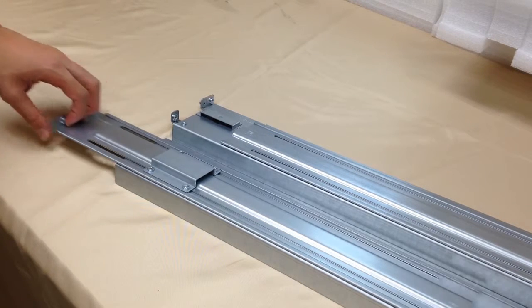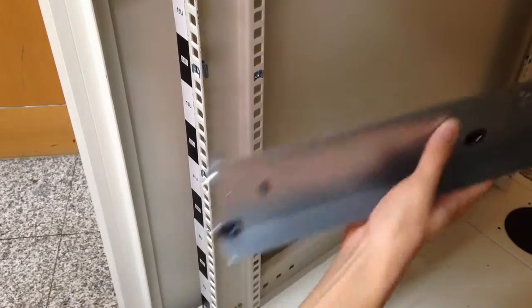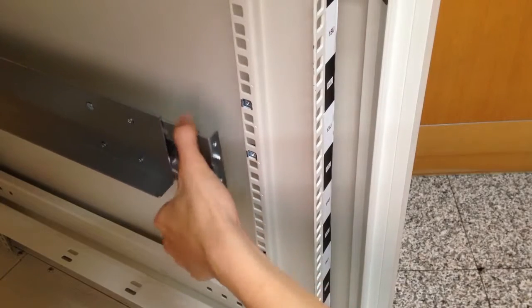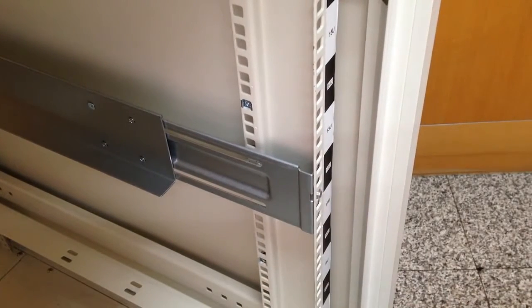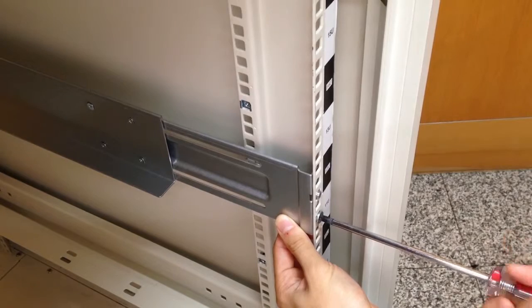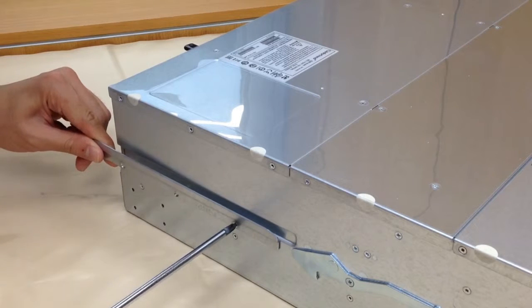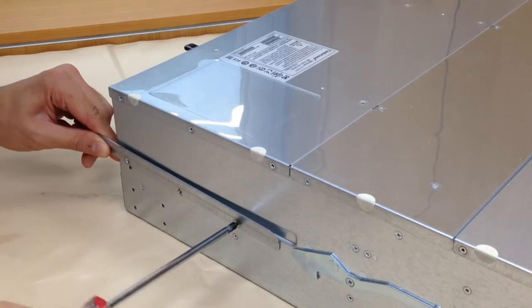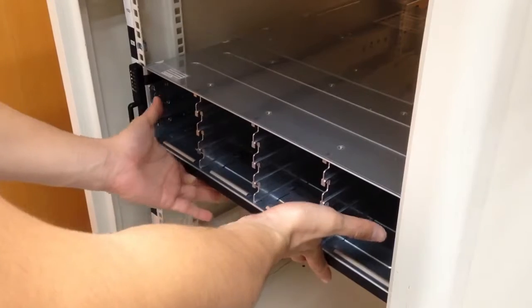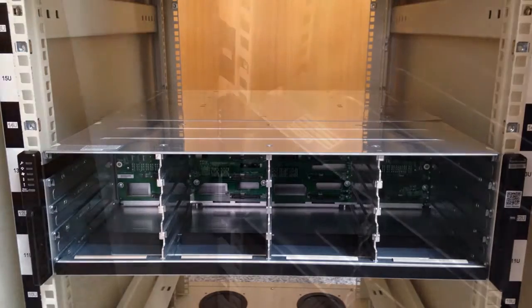Please pull the slide rail kit to an appropriate length. Horizontally place the rack mount front in line with the bottom of 11U. Adjust the rack mount length again in line with the bottom of 11U, then fix the latches. Fix both sides with screws. Rack mount inner glides of the slide rail kit need to be installed on the two sides of the enclosure chassis. Place the device on the installed rack mount, then slide the bottom of the device to the position in line with screw holes on the rack and fix with screws.